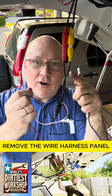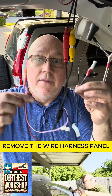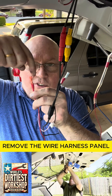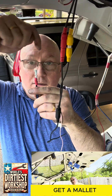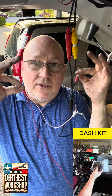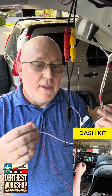If you have really tiny wires because the car stereo company left you with really tiny wires, it's going to suck. What you can do is twist them to much larger wires and then crimp them using butt connectors. That way you've got this whole spiral of wire all the way up, and then it's crimped. If the crimping isn't what's really making the connection work, it's the rest of the twist that's making it work. It's holding it steady, and you can tape it so that it doesn't short. Those are little secrets to wiring things that really don't fit, but it's going to work.